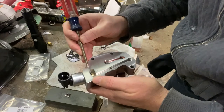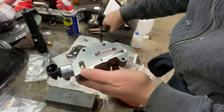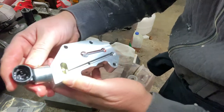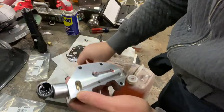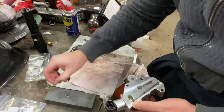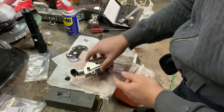The problem is this manifold isn't machined the same as an OEM manifold — it's a little bit thicker, so the pressure transducer groove doesn't line up right. There's about 20 thousandths of recessing, so you have to grind down the metal clip a little bit, which I did on the sharpening stone here.